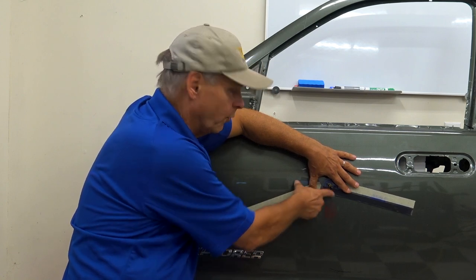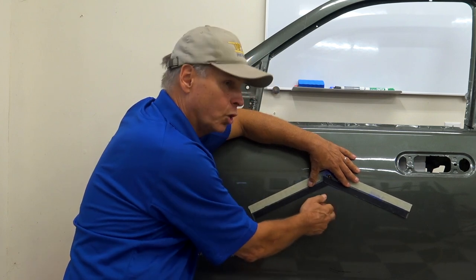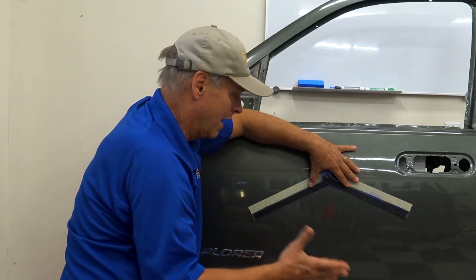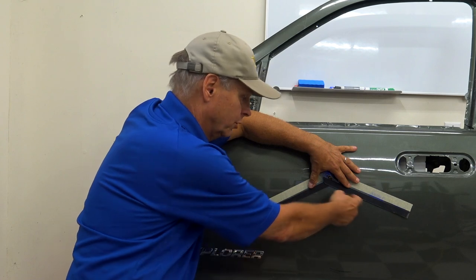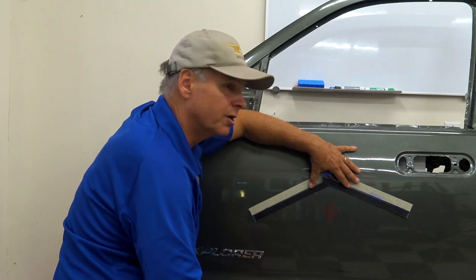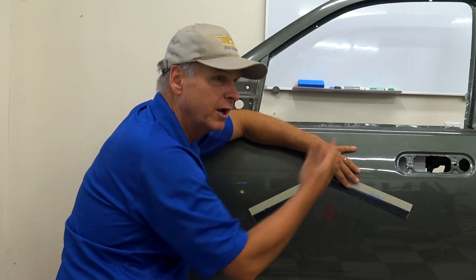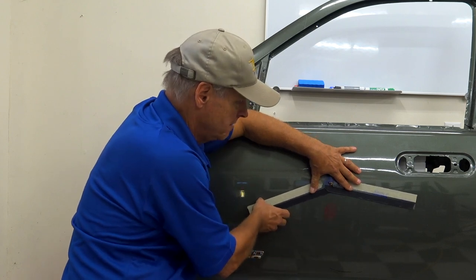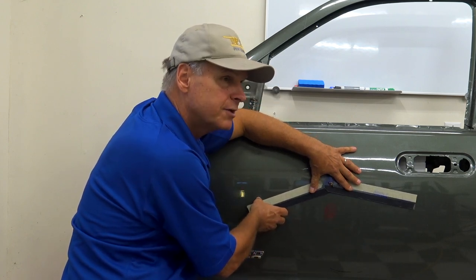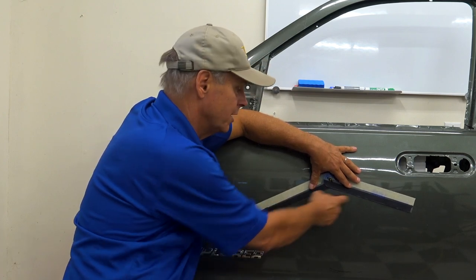Now, to go from 150 to 130, just a little tighter crown, it took quite a bit more force to do that. And over the years I've noticed, for every 20 degrees of extra crown angle, you can pretty much be sure it's going to double your finishing time. It's going to take you to remove from the breakover point. So at 150, it might take you 5 minutes max. At 130, it's going to take you 10, just for that extra 20 degrees, because there's double the amount of energy now stored in that crown.